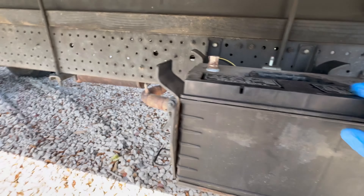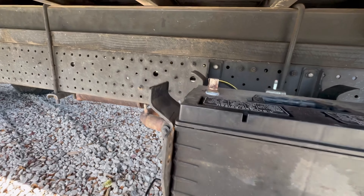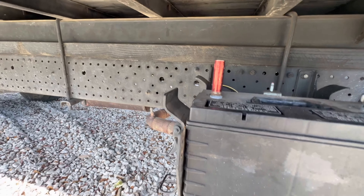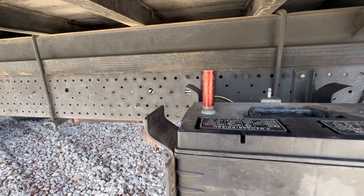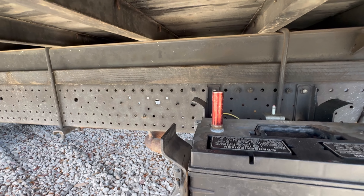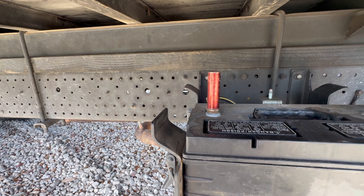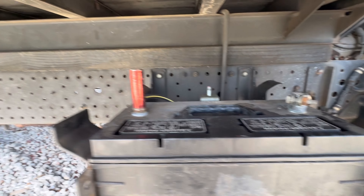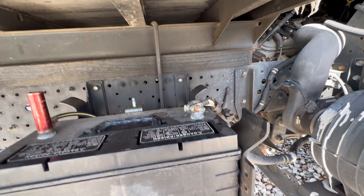As a rule, always in your life when you're going to replace the battery — remove the negative pole first. That's the main rule. This is the first one removed and the last one to be hooked up, to be safe. That way, even if you touch the positive and the ground, there's no ground connection and no risk.